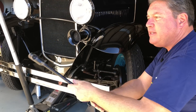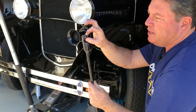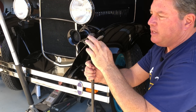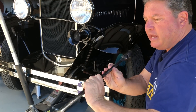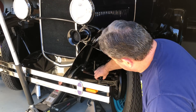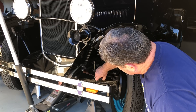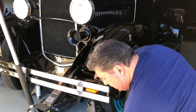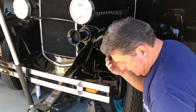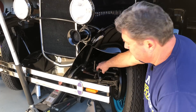Drag link out. There is a definite front and back to a drag link, by the way. That's the front — see, this space right here is real small. That's the rear — see, that space is real tall. The spring and all that is in here. So that is the way it goes in the car. While I'm here, I'm going to go ahead and swap out these little rubber seals and the little keepers because I've got brand new ones. Big ones go on the drag link and the tie rod ends. Little ones go on the shock links.